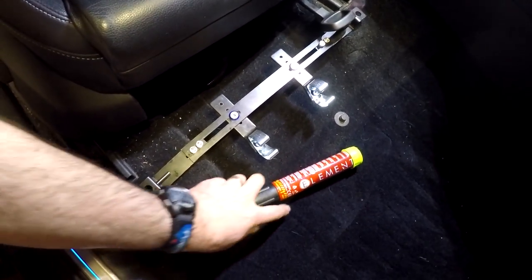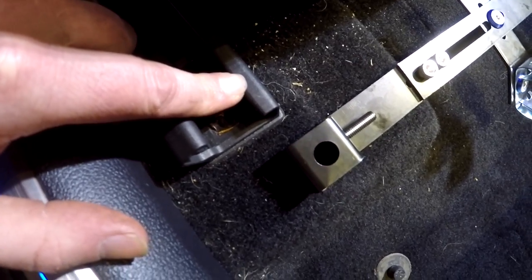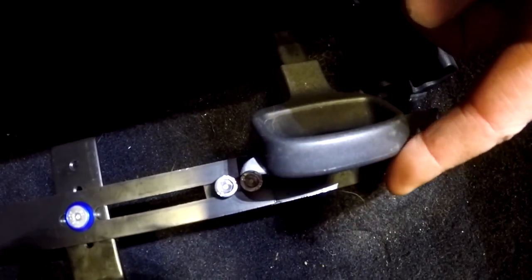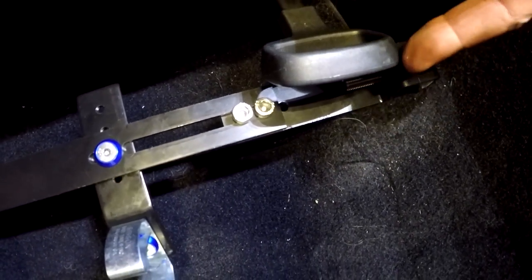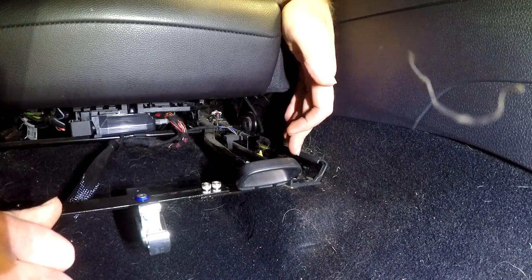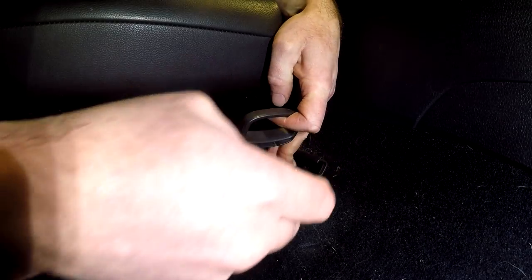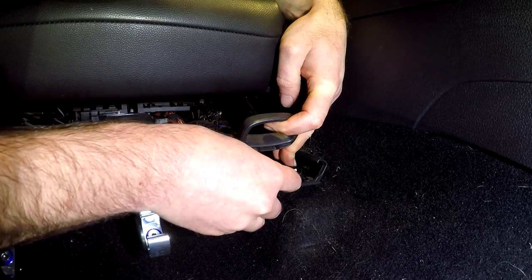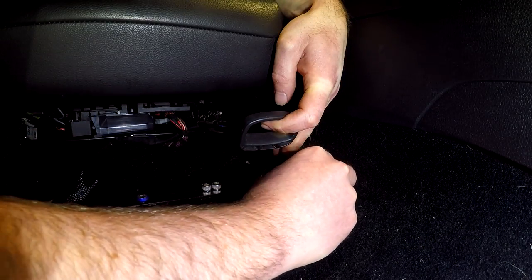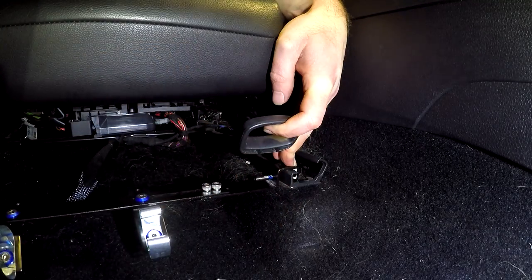Now that we've moved over to the car, I've removed the Element just so I can have it out of the way. We're going to be hooking this bracket on the inside of this part of the seat mount, and on this side, we're going to be mounting it once again on the inside of this seat mount. You may have to pull your seat adjuster up a little bit temporarily to get this into place and to tighten the set screw. I'm going to first do the inner bracket. I've got maybe a quarter inch back from the end of the track here, so I'm going to be pushing down with one hand while tightening in the set screw with the other. I'm going to tighten this in until it's really snugly clamped. You do want these two bolts pretty snug at this point so that the bracket stays flat.